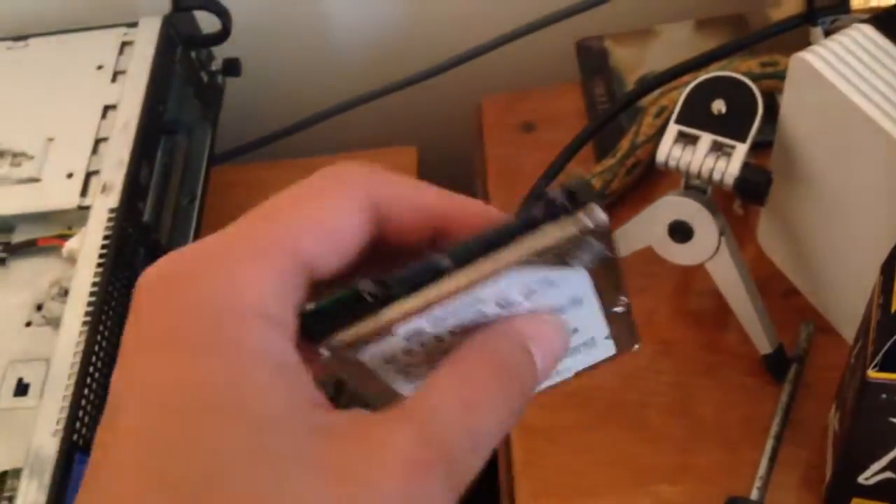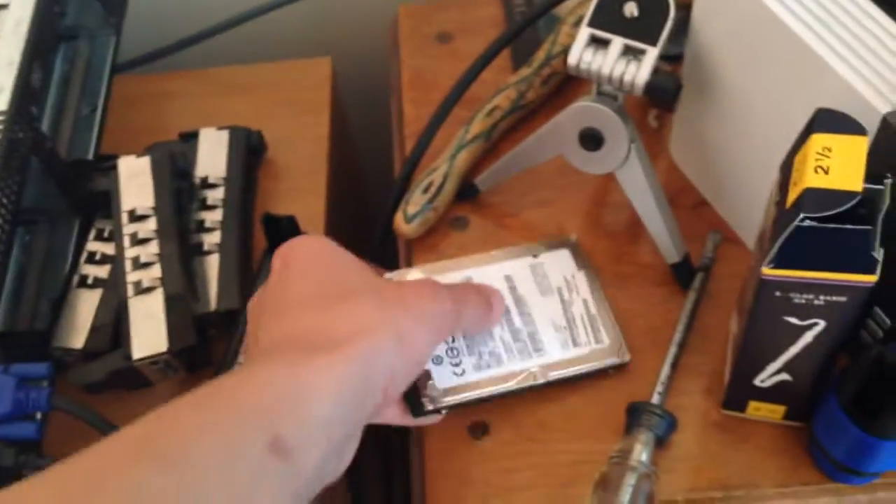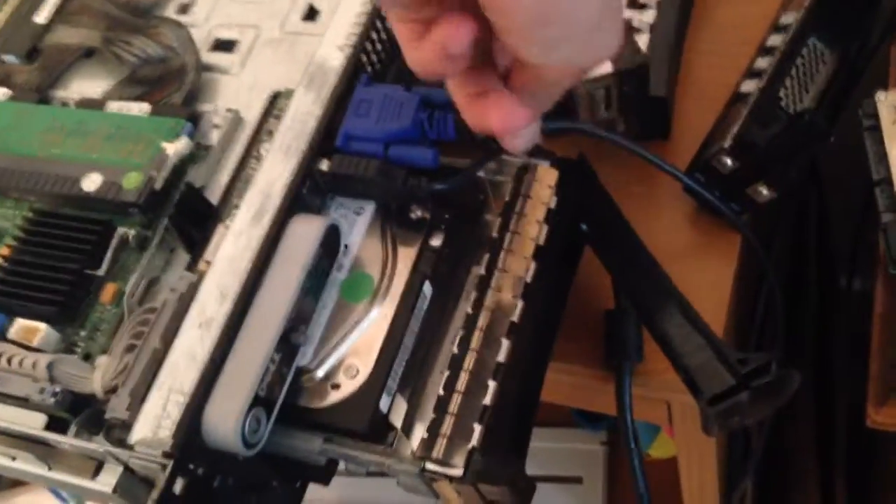I know I'm going to be using it for storage. I've got a bunch of these really crappy salvage laptop drives, and I think I'm going to put a bunch of them in RAID 1. Because I have 6 drive bays, these two are populated with SAS drives, which I'm using for the OS. It probably wouldn't hurt to put SSDs in them, but I can't afford it — SSDs are expensive.